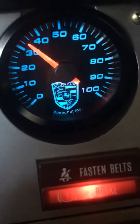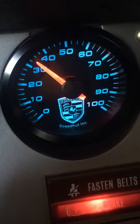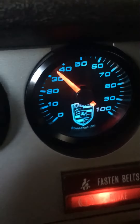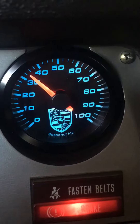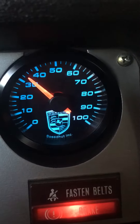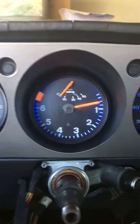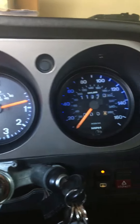And that is my fuel pressure while the car is running. If I let off, it wants to die and the pressure just is moving around. It's getting heavy smoking out of the back. The car is not happy. Horrible missing.